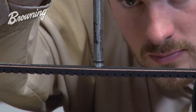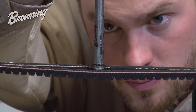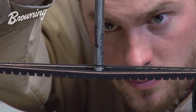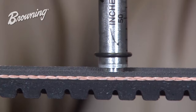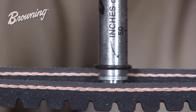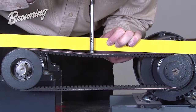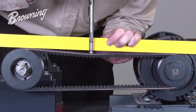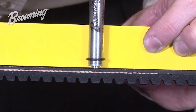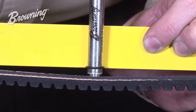Referencing the plane the belt was previously in can be determined by two methods. In a multiple belt drive, simply deflect until the bottom o-ring is in line with the top of one of the other belts. In a single belt drive, you will need a straight edge or a piece of string to run across the top of the belt and then deflect until the bottom o-ring is in the same plane as the straight edge or piece of string.